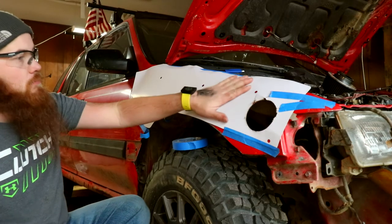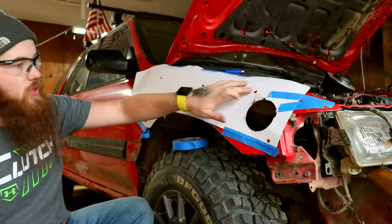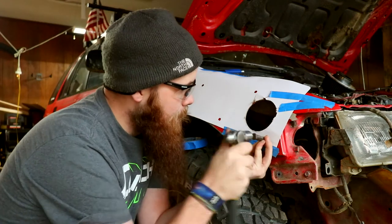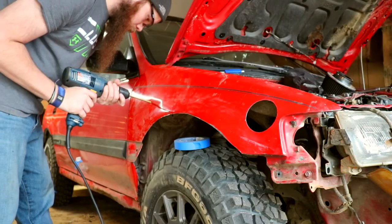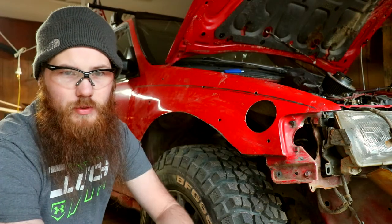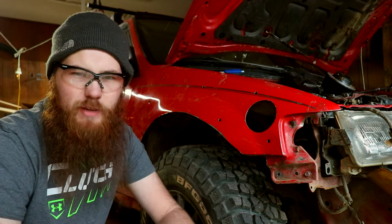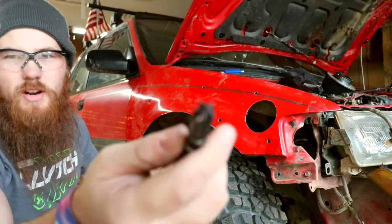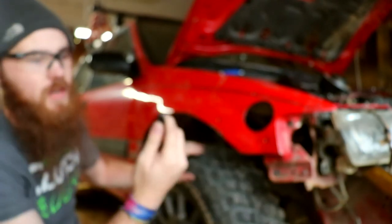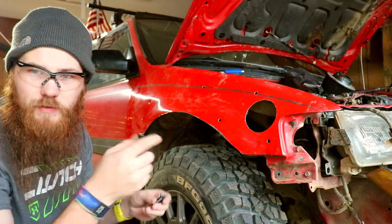While I've got this template up here, before I take it down and start painting the hole I just opened up, I'm going to go ahead and center punch these so I can drill them out. That way I can get everything ready to mount the snorkel. Now I'm going to deburr these holes so they're not sharp. I have a new deburr tool I haven't had a chance to use yet. This deburr tool has a lot of flutes — the more flutes it has, the easier it cuts. I was just able to put it in and give it a turn and it was good to go. I highly recommend one of those.